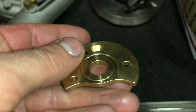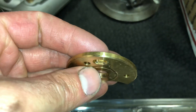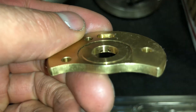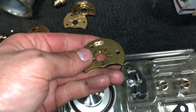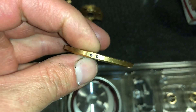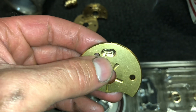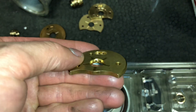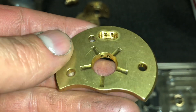This is the other version. These were not drilled from the bottom or top either — they were drilled from the side also. So the holes are still too small in this version. This is the thrust bearing that we use. They're drilled from the top and then plugged up. Holset did that a lot on their thrust bearings but not all of them. You can see how big the oil feed holes are in comparison.